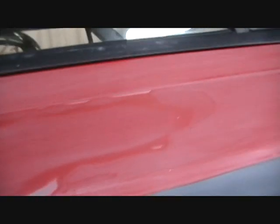Well, I ended up having to go to 180 grit to get that feather edge in there, and then 320, taking it down to a 400 grit. I'm using a solid darker color with a flat clear over it. Normally I'd take it down to a 600 grit for a metallic or something. But yeah, that was ridiculous. That whole area was completely shiny. Then I blew the dust off with the air gun, and everything in there just blew off. That's hopefully the worst of it, as I want to just get this thing painted.